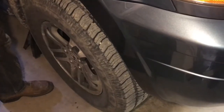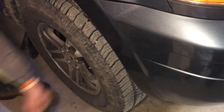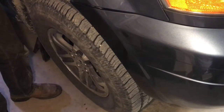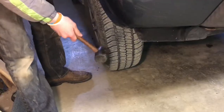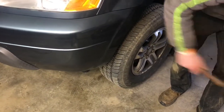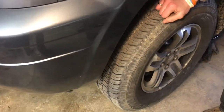So if we pound this wheel — I don't hear anything. Just hit different places on the tires; you can use a small sledgehammer, just anything that can apply force. Now we'll hit here on the driver's side, and I think I hear that rattle.